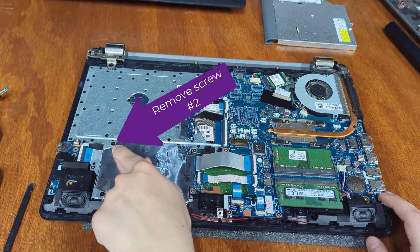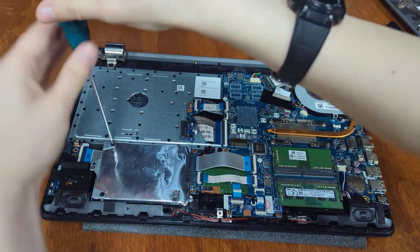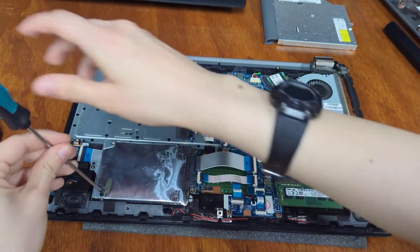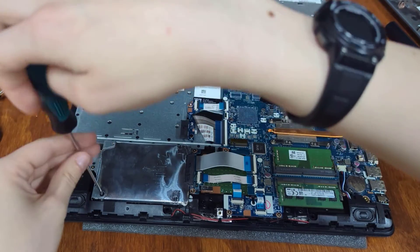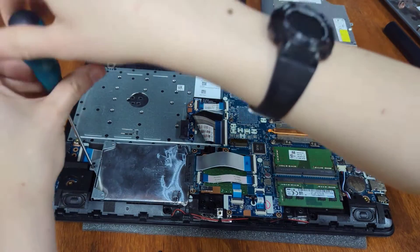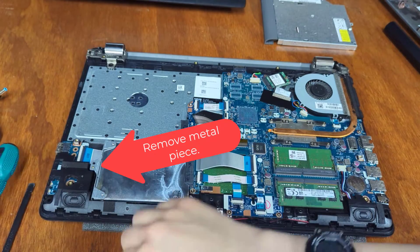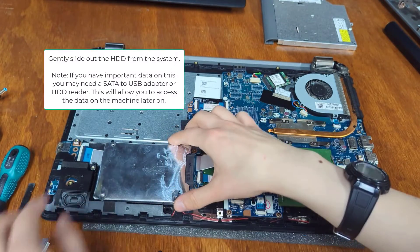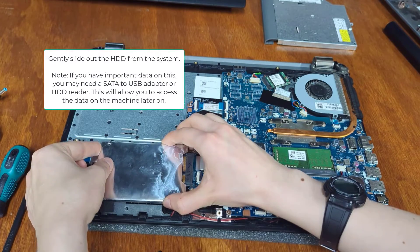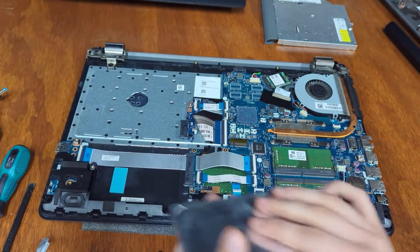For this process, I'm just going to take these three screws out and get this hard drive out of the machine — one, two, and then this third one that holds the metal plate to the laptop itself. You can pop out this little metal piece and then gently wiggle the HDD from the system out of the SATA port there. If you have important data on here, be extra careful as these drives can be really fragile with their spinning disk.